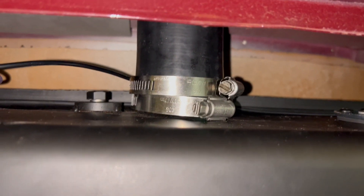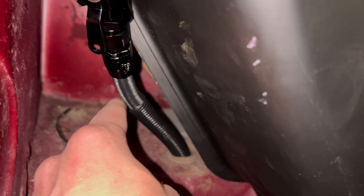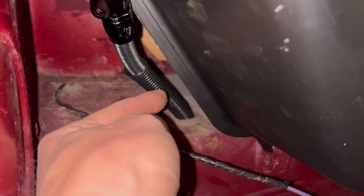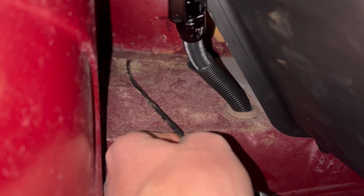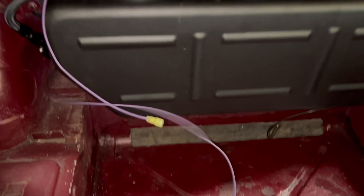I got a new piece of rubber to connect the filler cap. Here's my line that runs down — I did put a shutoff on it in case I ever need to service it, or if you're parking in a not-so-good neighborhood. I put some extra sheathing on the line where it runs through the body. I used a different grommet here because the original one wouldn't line up right with the tank sitting on top of the line. There's where my line runs through the passenger compartment — I found a good spot and wrapped it with electrical tape for extra protection.